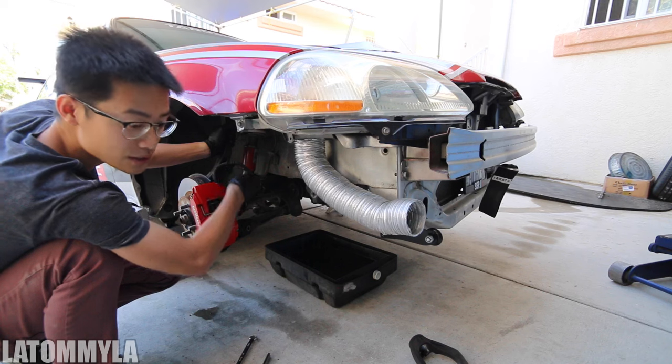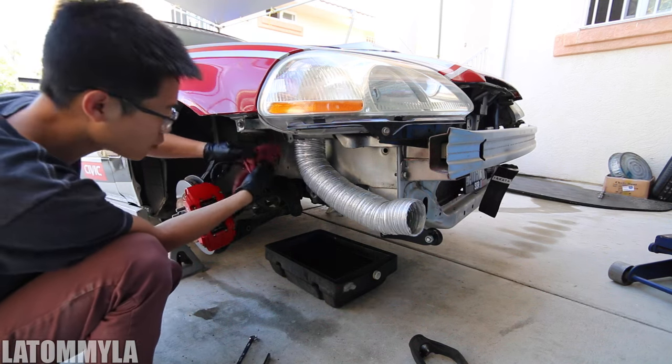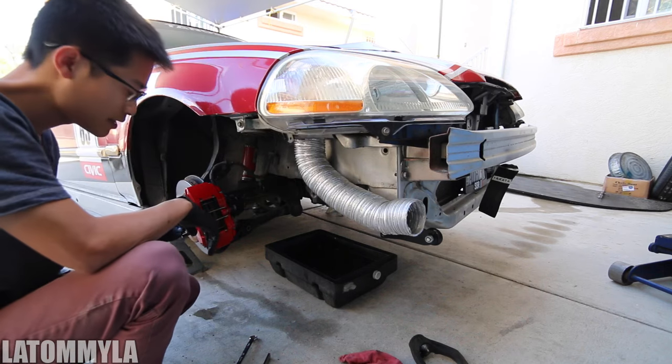If you have a slammed car it is hard to take off because of course the car is slammed, so there's a lot more pressure on the ball joint and it gets stuck inside the knuckle. I used to change my axles on my slammed car - it would cause so many problems, it's so hard to take off. I'm sorry if my camera's in one position - reason is because this is really dirty and I don't want to get my camera dirty. So this is out - I need to clean this, it's really dirty. Turn the wheel all the way and take out the axle nut.